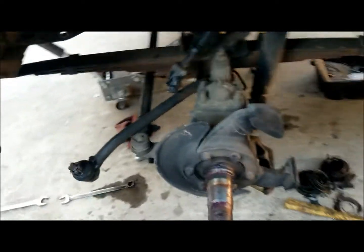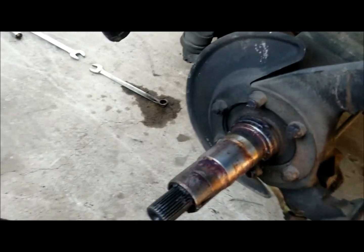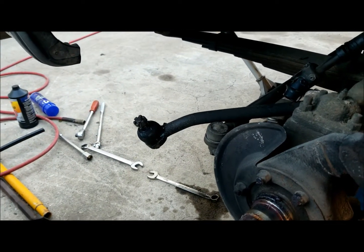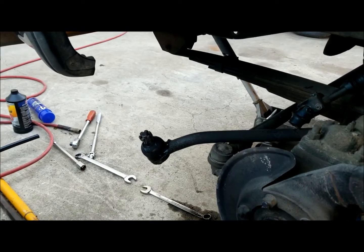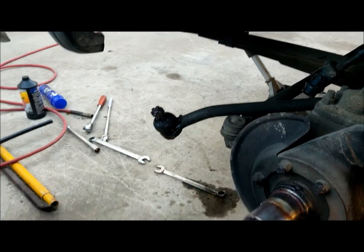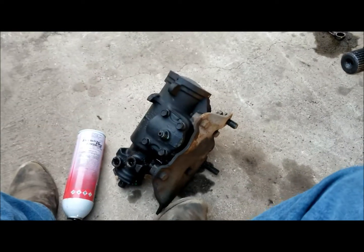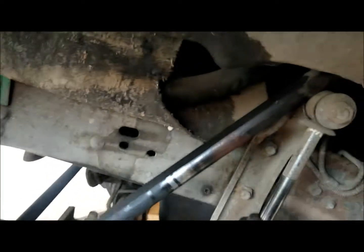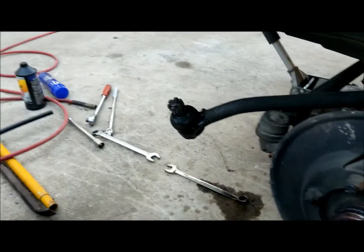What else? All the steering, I did the steering the same time I did that gearbox, so it's pretty low mileage. It's all Moog stuff, which seems like it used to be good, and now it's not very good, but it's about all you can get now for these trucks. The Pitman arm I got from the dealer. Got a Borgeson shaft in there. I'll re-grease all of this.